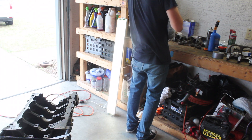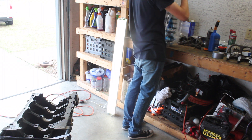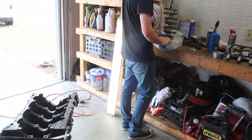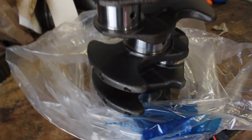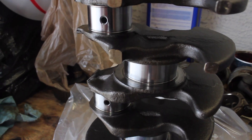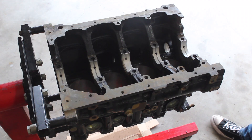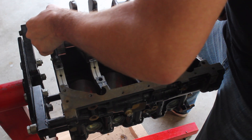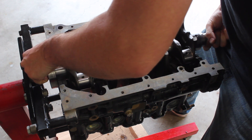Now I'm going to take the crank out of the bag and put it into the block so I can check the clearances. The crank is already really clean and I haven't taken it out since I got it. So I went ahead and sprayed it down with some brake parts cleaner and aired it off, wiped it down with some blue towels, then aired it off. Now I can put the crankshaft into the engine block — this is kind of heavy, so you want to put it down nice and slow and easy so you don't damage anything.